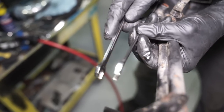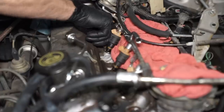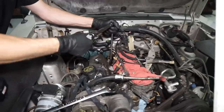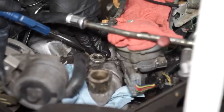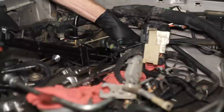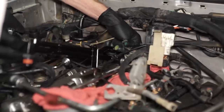If you notice, the lower intake manifold stud was removed along with the heater tube. Use a thin wrench to hold the stud while you remove the half inch retaining nut. Reinstall this studded bolt back into the lower intake — the torque spec for this one is 18 pound feet. Take this time to clean the area. Thoroughly clean and inspect the threads in the lower intake. Before installing the heater tube, lubricate the O-ring in the swivel fitting. Ensure that the two hose clamps on the rear heater hoses are on the hoses.